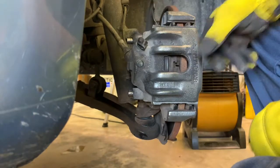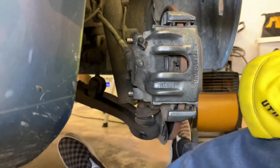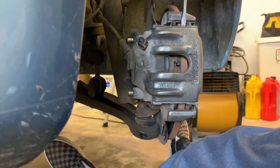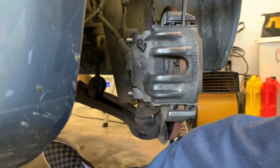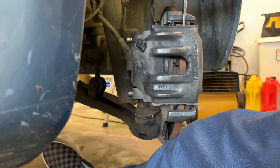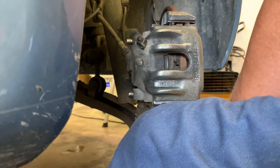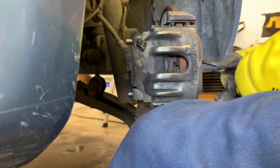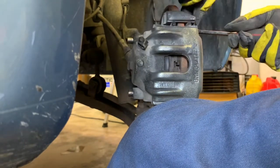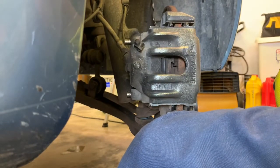Let's get the caliper off. I might still have that bar on the brake - let me go take that off. There was a little bit of brake pressure left from when I had the bar on there, so we'll just use the screwdriver to kind of pry the caliper off. Let's take this clip out before I let the caliper loose.